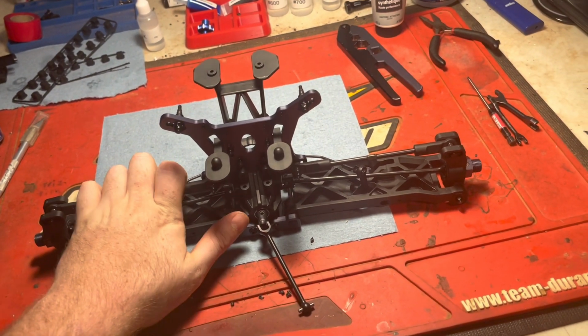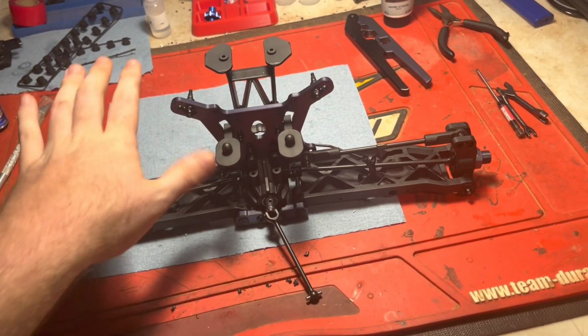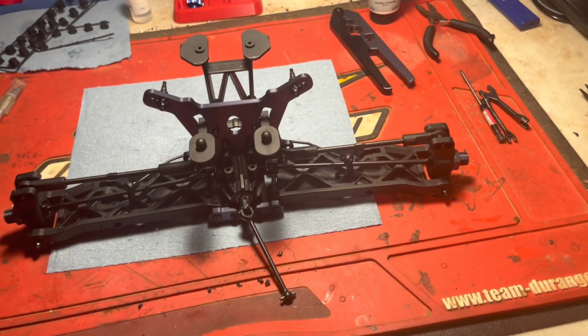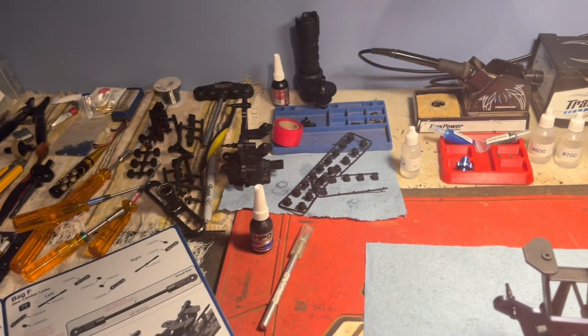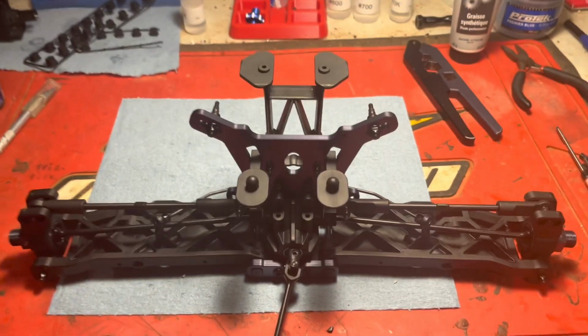Camber links are close to the book. I want to put it on my setup station to get the exact camber that I want, which is going to be -2, -2, -2, -2, all the way around. So yeah, she's doing pretty good. We got some parts left over there, and then there's the box down there with some stuff. I happen to have Cars 2 on over there, just something in the background to listen to.